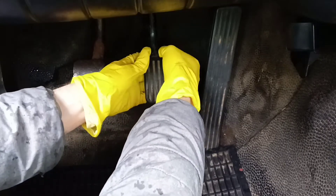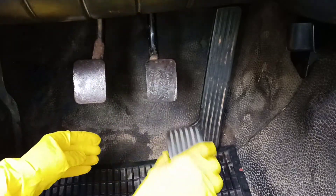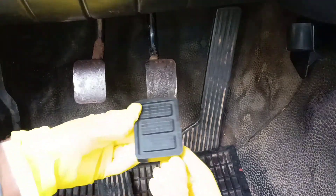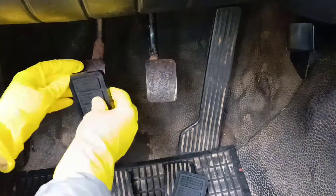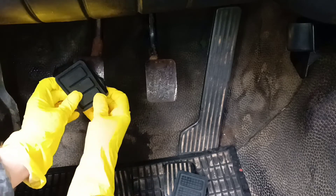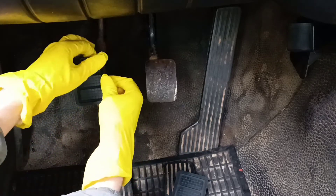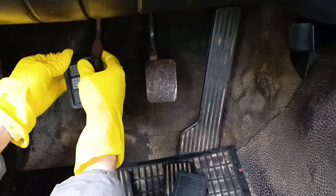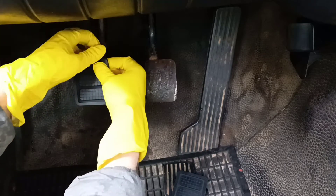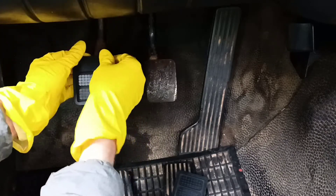Remove the old brake pedal part — we'll install the new parts right now. Parts are ready to install; let them lie near the pedals. Take notice that the cut-out is in the lip. Install the bottom part first, and then the lip wraps around the steel part of the pedal. For installing the rubber part fully in its place, you can use a small screwdriver. Make sure the lip goes all the way around.